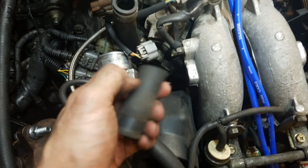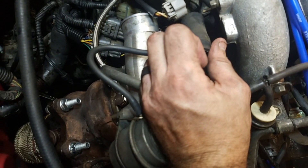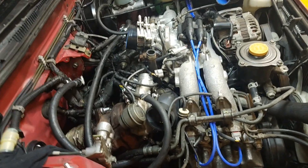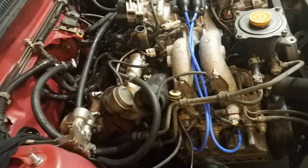I'll use that hose, then get a plastic 90-degree bend coming up this way, and another one coming this way, and end up putting it into the pipe right about here. A lot of people run into issues because there's so much going on in this small area. The intake is going to go right there — just a 90-degree elbow coming out this way — and the filter will go right where this flashlight is. I'm going to install the intercooler now. I already test-fit it — this G-plus from eBay is exactly what's needed because it sticks out really far, farther than what WRX guys need, but perfect for this build.